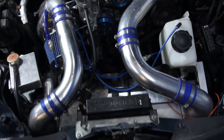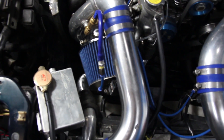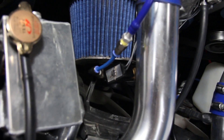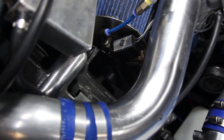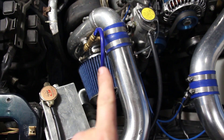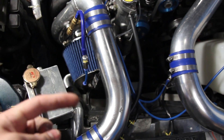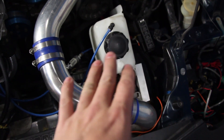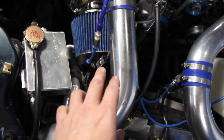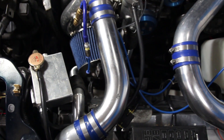Let's see a real example set up here. This is my first RX-7 — this is fully operational, working fully, beautifully, well. The nozzles are right hidden underneath there. Same kind of concept: the nozzle is sitting in the front of the turbo. That's a custom-made air filter. The nozzle is going into the front of the turbo right there. I've got air circulating — there is a small boost leak but it's so small it just recirculates. So the air pushes the water from over here, there's the filter, pressurize the water tank, it gets filtered, goes to the solenoid — the little safety stop gate — and once it gets the go signal it lets air and water mix and go into the front of the turbo. That's the whole setup.